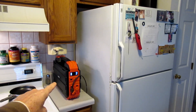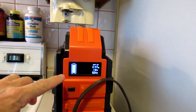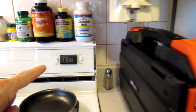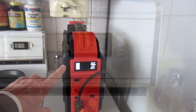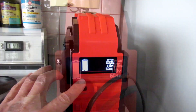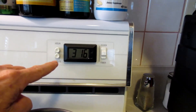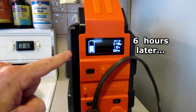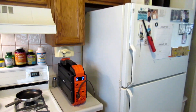The main reason I bought this is to run a refrigerator on an extended blackout. It is running at about 147 watts. I'm going to let it run all day. When the compressor cycles off it's only using 6 watts. It is 3:16, about 6 hours later — battery has gone down to 50%, so I'd guess it would run about 10 hours total with the refrigerator.